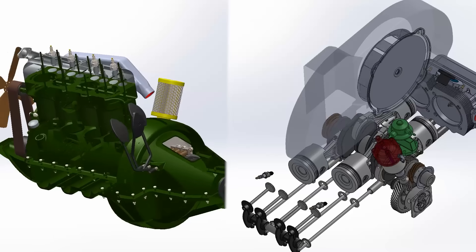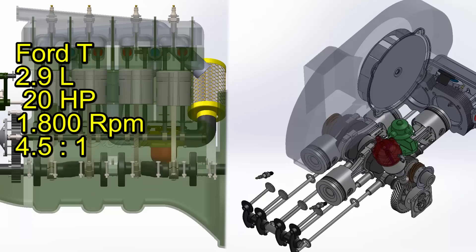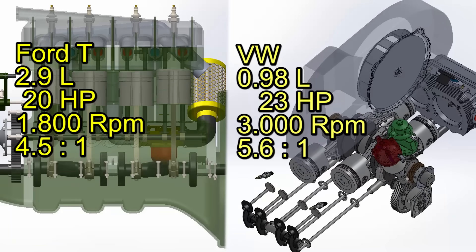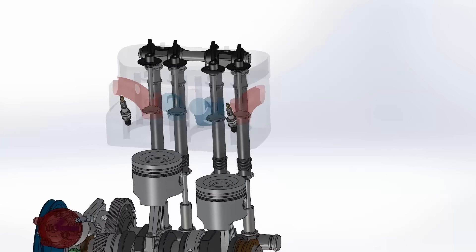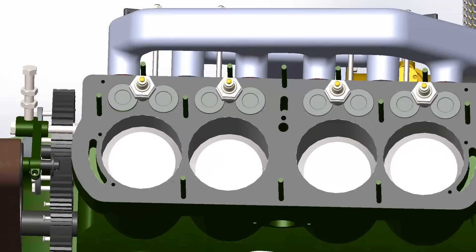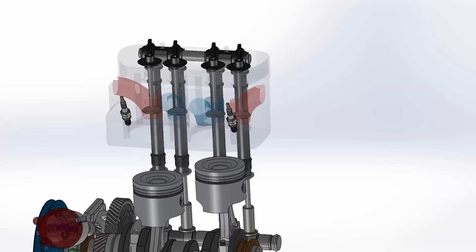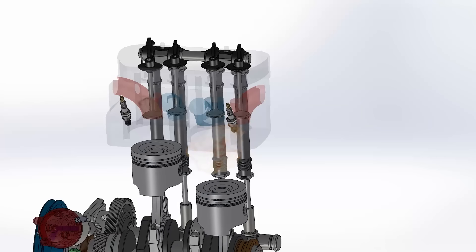Compared to a 20-horsepower, 2.9-liter Ford T, the Beetle had slightly more horsepower but three times less engine size, although the design was 20 years newer. The valves were in the cylinder head, while the Ford T had them in the block. Having the valves in the head significantly increased the entry and exit of gases, especially when the engine rotates fast and the time of each cycle is shorter.